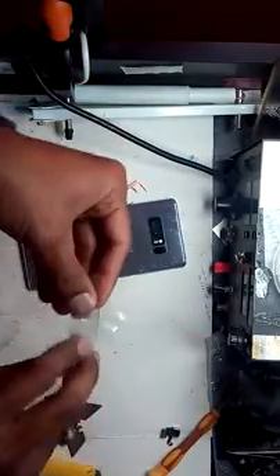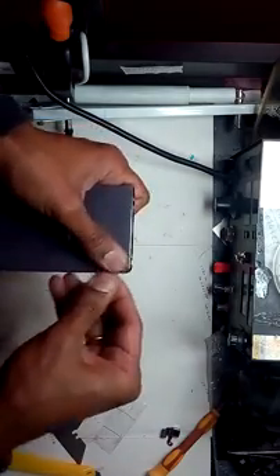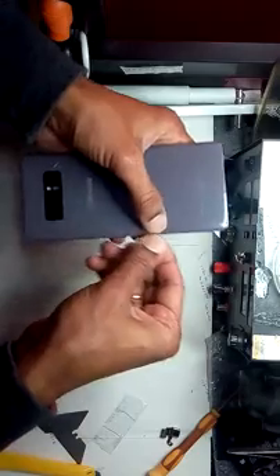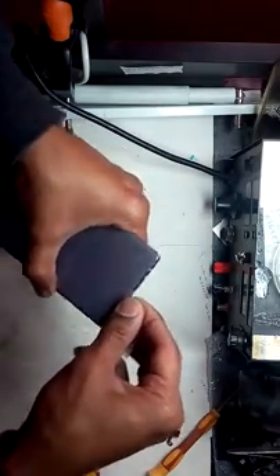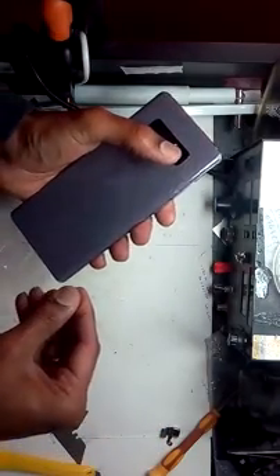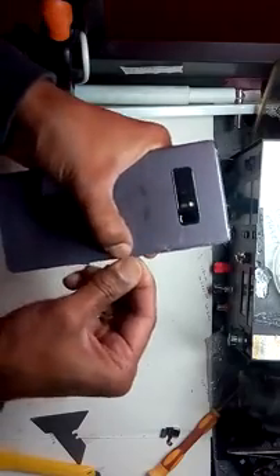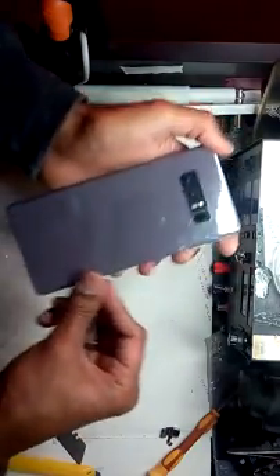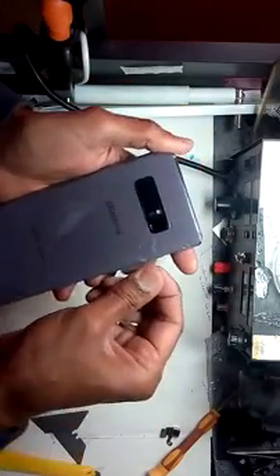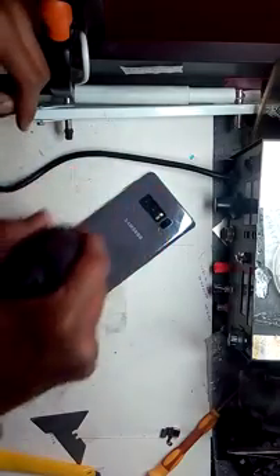This is the easy part - you can use this kind of plastic tool so you can just pull it up a little bit from here and slightly remove the glue as much as you can. Now be careful about the other side where the fingerprint flex is. The Note 8 glue is a little bit hard to remove, so you have to reheat it once again a little bit so you can easily remove the back.